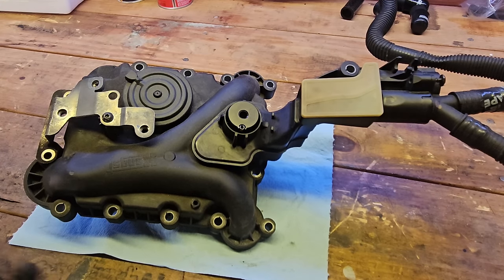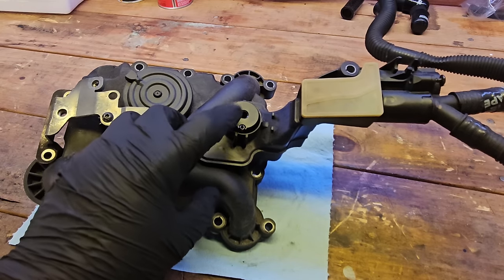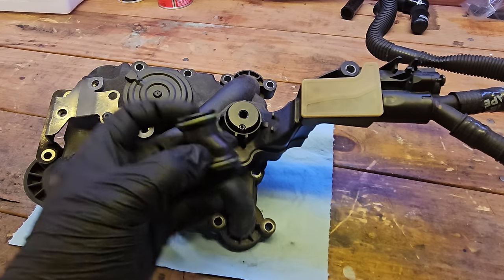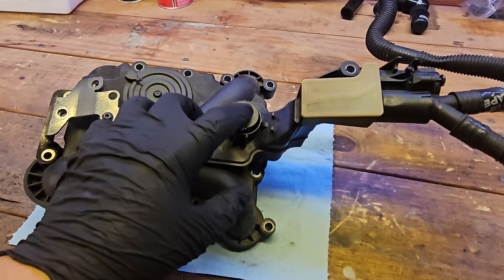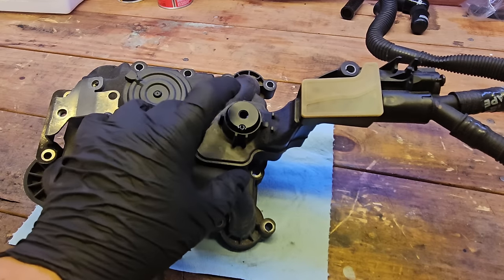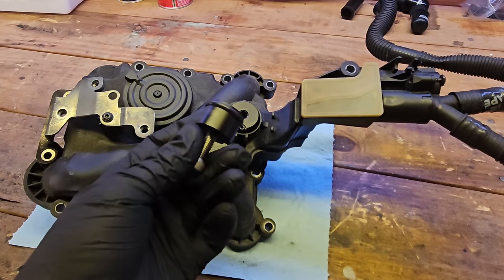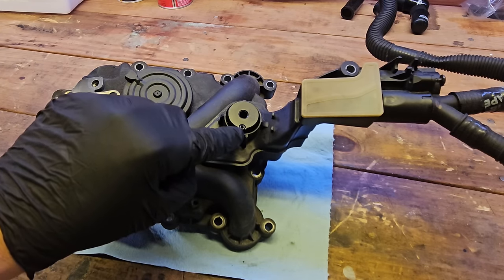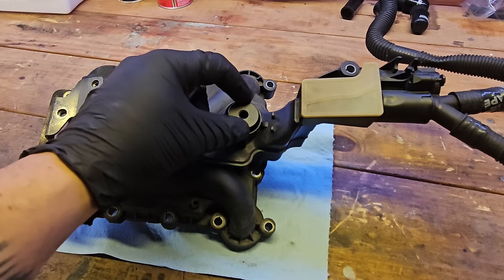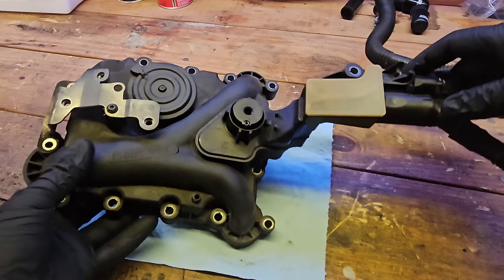Now let's talk about preparing your OEM PCV system for the MRA 1900. The MRA 1900 has no bottom-located PCV return line, so we have to relocate it. First, remove your OEM chimney stack and install one of the Merck Racing supercharger plugs in its place. These come with a gasket, the plug, a screw to aid installation and removal, and a small dowel pin to secure it into the PCV. Pull the chimney stack out, put the plug in, insert the dowel, then remove the bolt — don't leave that in there.